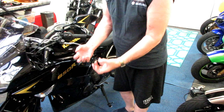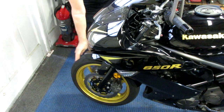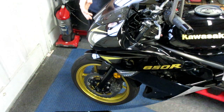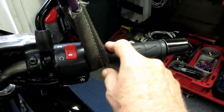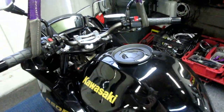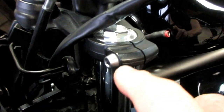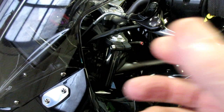We're going to show this in real time. We only need to raise the bike so the front wheel is just off the ground — just enough to take the weight off the wheel so we can turn it. A couple of good tips: be real careful you don't pinch wires, cables, or whatever when you put the straps in. In this case I just put a knot in a strap to make it smaller and use the hand grips — that's always a good thing. I like to have the bike as solid as possible while working on it. There are six bolts that have to get loosened: two down there that we may have to get from the bottom.